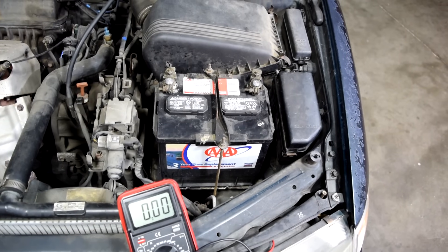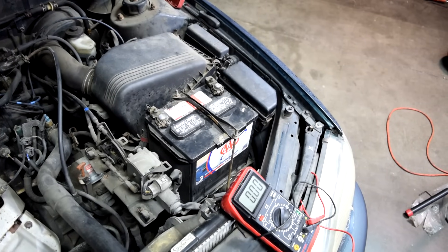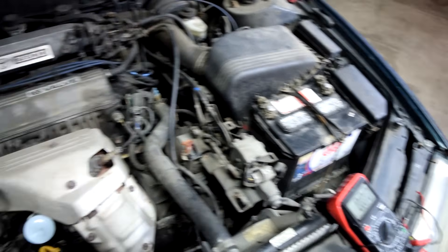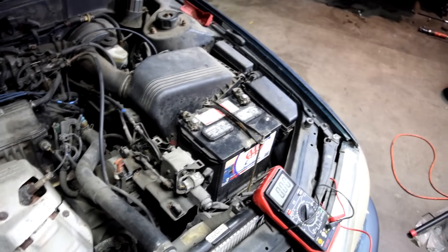You need to take this battery out and take it to your local auto parts store where they'll recharge it and then test it. It's important to do this properly — you can't just get a jump start, go for a drive and hope that your alternator recharges it. Your alternator alone cannot fully recharge it and then you'll be back at square one.